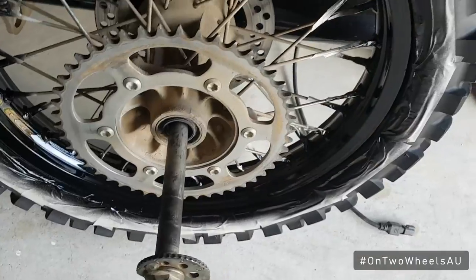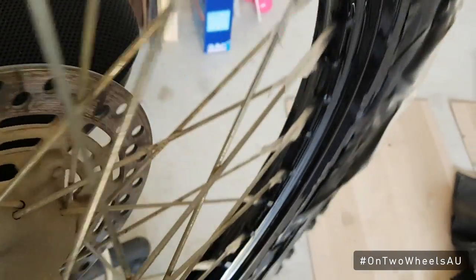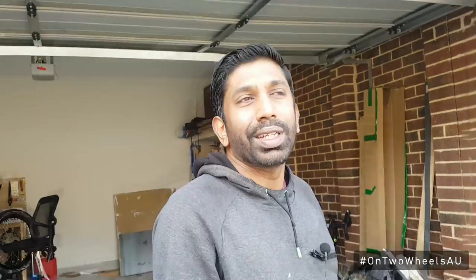The rear wheel is looking really nice — the gloss is amazing. Moving to the front wheel, the paint is also in really good condition. I did have a few specks of dust settle into the wet paint, but there's nothing I can do about that. Today is the next day — I let the paint dry overnight. I laid down about three layers of paint; after the second layer it was already pretty good, but an extra layer won't hurt since the rims go through rough terrain and are prone to chipping. Next I'm going to apply the clear coat, which gives a finer shine and extra protection.